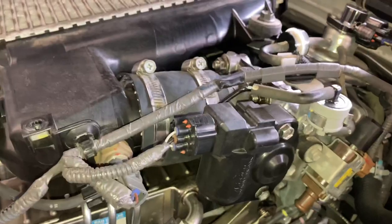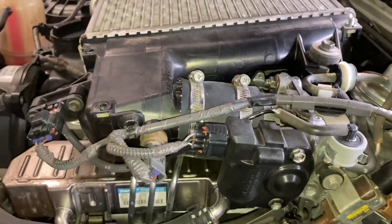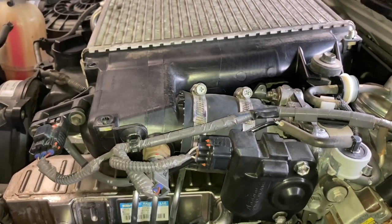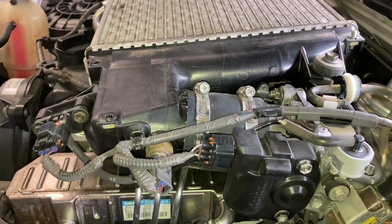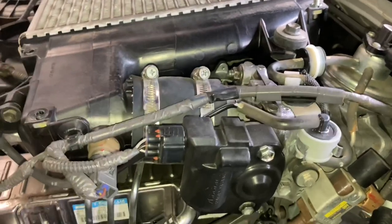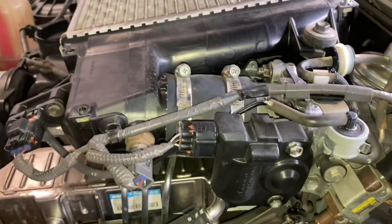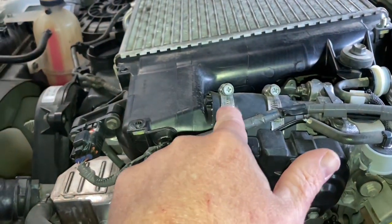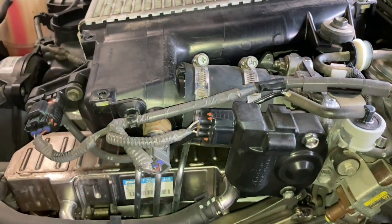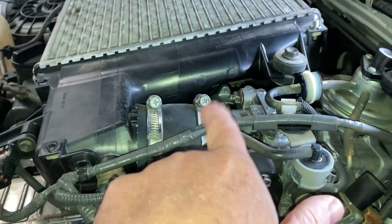This is your driveway where the vehicle gets parked — by any chance it's slightly nose down? I'm getting the yes nod. When you understand vehicles, this is how quickly you can figure stuff out. You said you took the intercooler off to have a look around — and when you took it off, did you only undo this clamp and not that one? Yes. Okay, so my suspicion is we've left this one a little bit too loose.